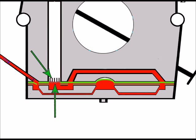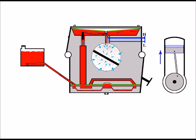They're generally quite inexpensive and they're easy enough to get hold of. If you just do an internet search with the details of your machine or the details of your carburetor, you should easily get hold of a gauze filter. But in the interest of the blockage there, you can see the result is the same. The fuel's been used above the blockage, and now we're left with no fuel going into the engine and no working engine. Now let's take a look at another area of the carburetor and how any deficiencies in that area can cause bog down.